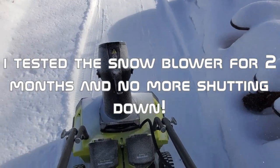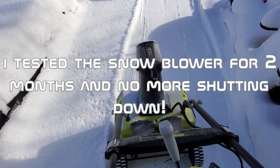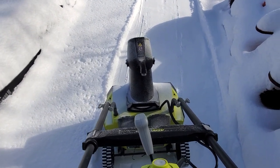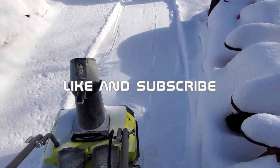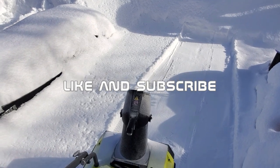So as you can see, this is powdered snow about the same consistency as the last time when I was getting a static shock, and the machine's not stopping. So I think it was the discharging of the static through those wires that was causing the machine to shut down in the light snow.